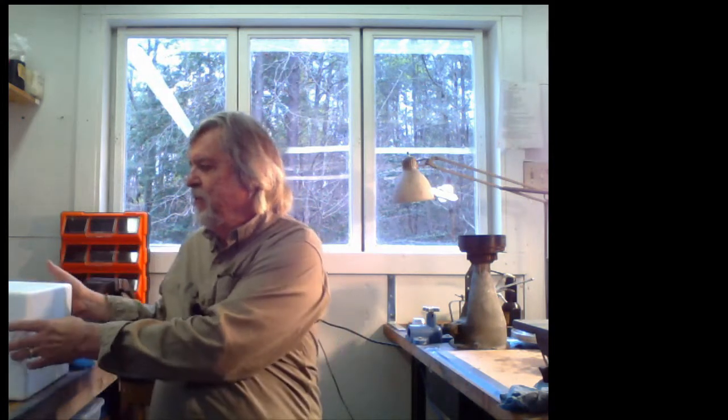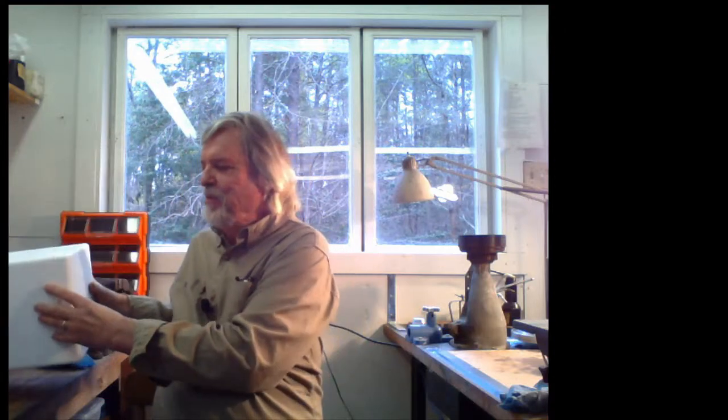Welcome back to part two of my video showing how to use my new sizer tools. Now in just a second, I'm going to go over to the refrigerator I have here in the shop. I'll remove the freezer bag that has the direct clutch piston in it, then come over here to the table and install it on the drum. Then I'll probably turn the camera off. I'll go in the house and get the forward clutch piston and the intermediate clutch piston, and I'll bring them back into the shop in this little styrofoam box. Hopefully that'll keep it from thawing out, and then I'll install those. We'll see how it goes.